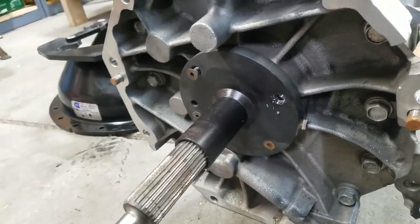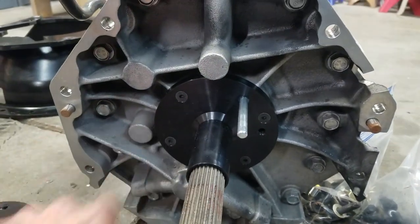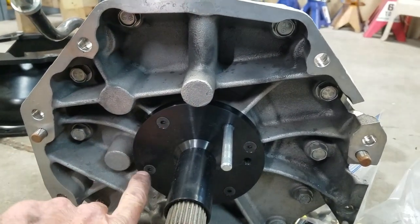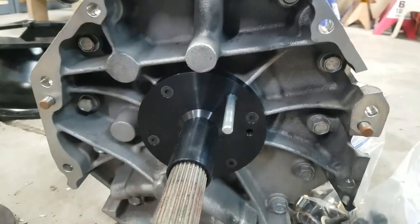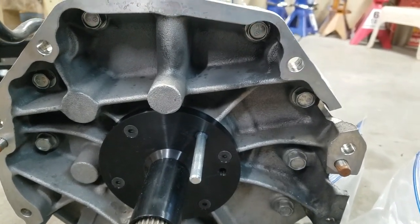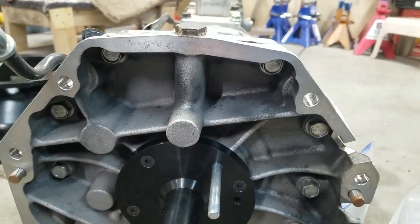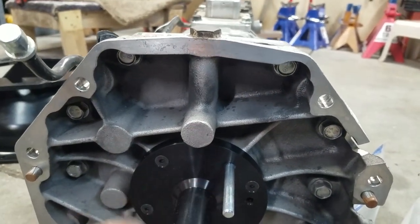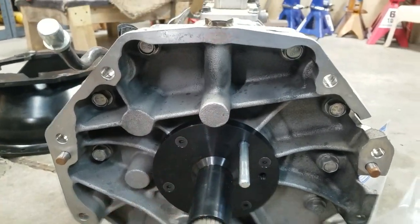And work from there. Now for the four bolts, they're Allen heads with beveled. I put a little drop of RTV or Loctite blue, just a tiny little drop. And then on this too, I got to tighten this a little better. I might have to just tighten it with a little pair of pliers, I guess. And they suggest 15 foot-pounds of torque.